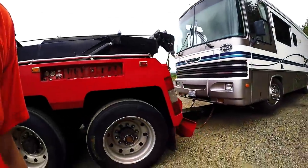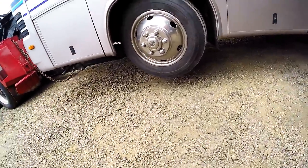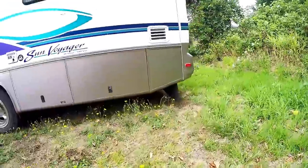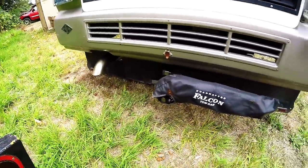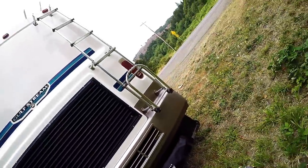Just a friendly reminder from your neighborhood tow truck driver: clean up after your dog, please. We're all hooked up — got our safeties, got the chains good, six inches off the ground in the front. Tires are all good. Back end's not dragging. Sometimes you'll drag that little rock guard down there, but that's kind of what it's for, so it doesn't really matter.